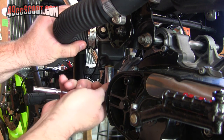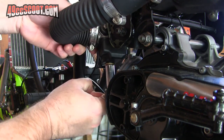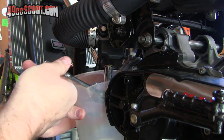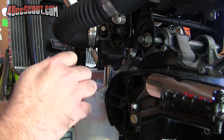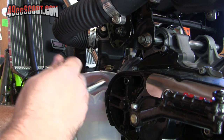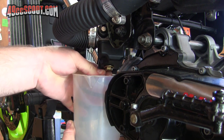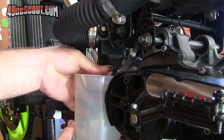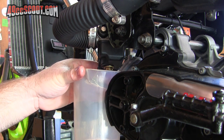While it's up on the bench, I'm going to go ahead and switch this main jet out from a 112 down to a 108 — partially because I don't have a 110, and partially because if it is sputtering at wide open throttle it needs a bigger step to be a good tune, even though I hate taking too much of a step at one time. I'm paranoid about this aluminum cylinder since I'm not used to these and know how quickly they can melt a piston.